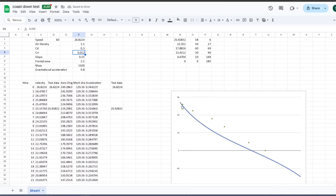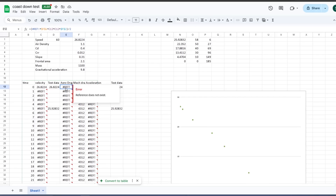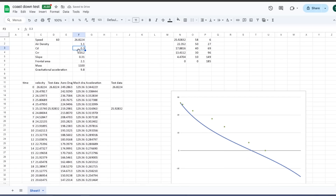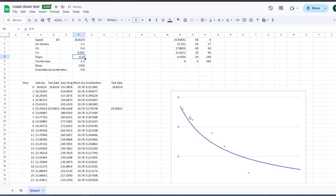If you put in a different coefficient of drag like 0.3, you see a curve that's steeper at the beginning and then levels off. If you had a really un-aerodynamic vehicle at 0.4, it becomes more pronounced like that. And if you reduce the mechanical resistance to something like 0.001, it becomes more of that shape — with a higher slope that drags on longer. But those are obviously unrealistic values.